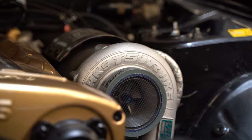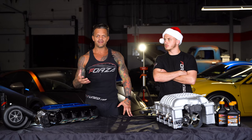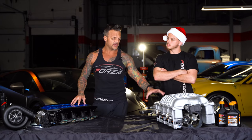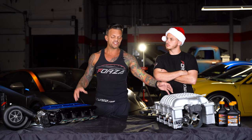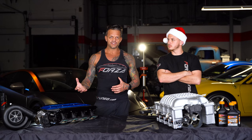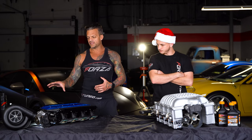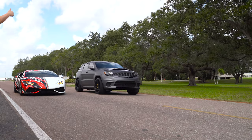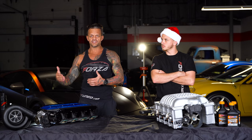A turbocharger has the most potential for overall power because it takes the least amount of power away from the engine to turn. For instance, the Hellcat supercharger is taking about 80 horsepower away from the engine at redline to drive itself — that's a lot of power consumed to make power. A centrifugal is a little more efficient, but it lacks bottom-end torque because it's strictly dependent on engine RPM, whereas the twin screw provides instantaneous boost — you hit the pedal, the bypass valve closes, and you have full boost immediately.